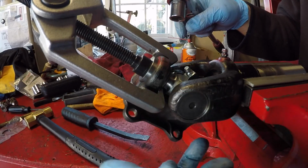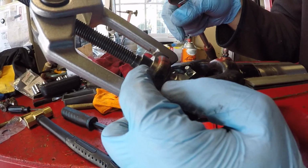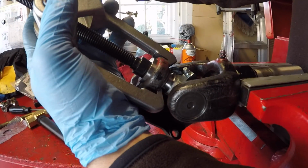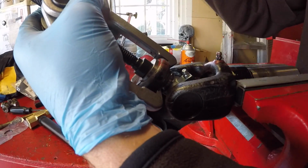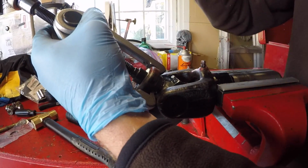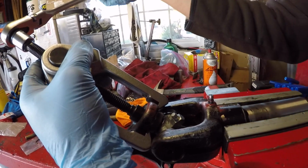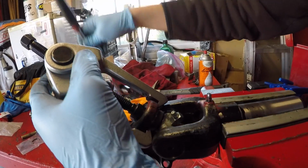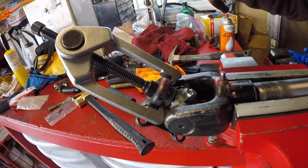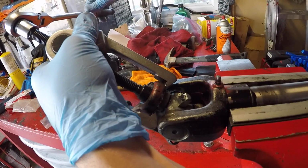We have the U-joint tipped in both directions to make room for our 2-jaw puller. And we're going to proceed to press this bearing cap in until the snap ring slot is exposed. It's going in quite freely. Not freely, but a good gentle amount of force. Okay, starting to show up. I think that's probably about it. It just barely slipped in, but we want to go just a little bit more to make sure that it's going to snap all the way around.